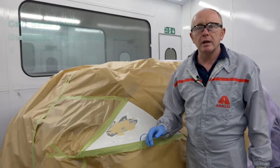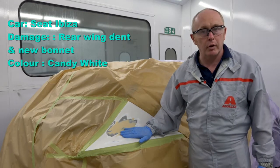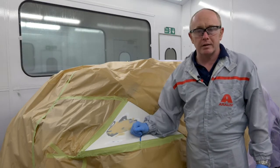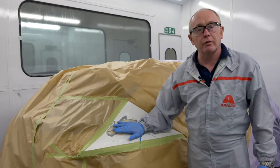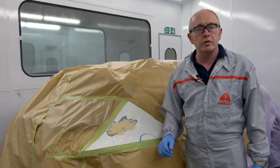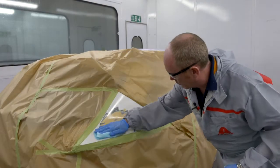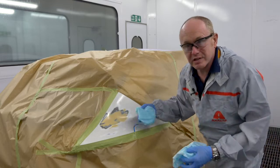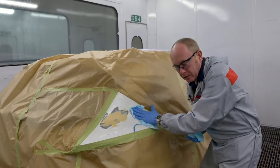Before I begin application let's have a look at the job. The repair is finely sanded, well prepared, and ready for undercoat — for the bonnet I'll come back to that later. I'll start by using the wipe on the bare metal and after a very short flash-off I'll apply the surfacer or filler. Make sure the repair is properly clean before using the pre-treatment wipe. The wipe is there to apply a corrosion protection layer and is not for cleaning the surface.